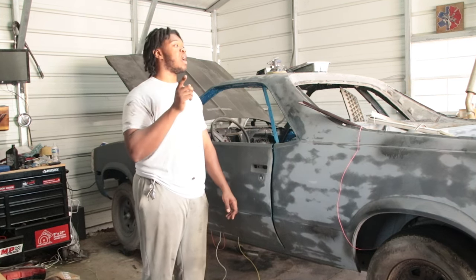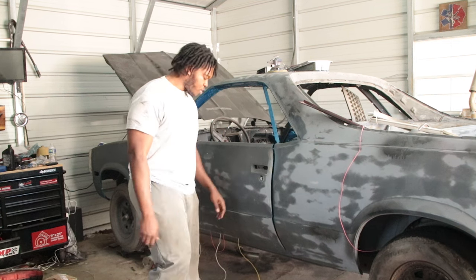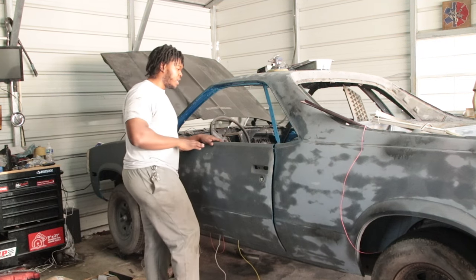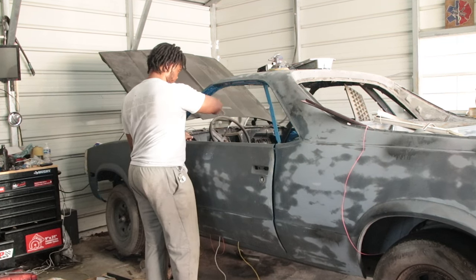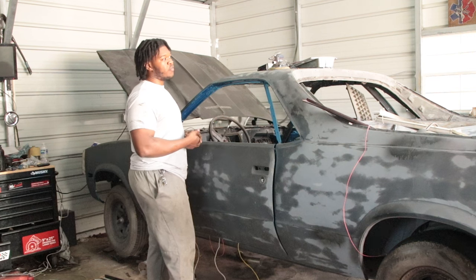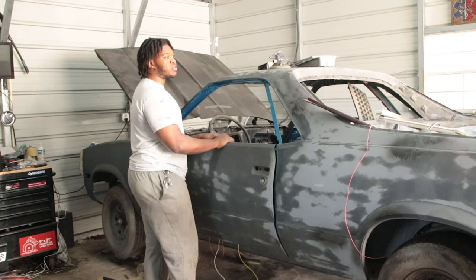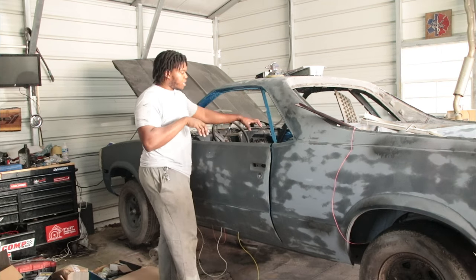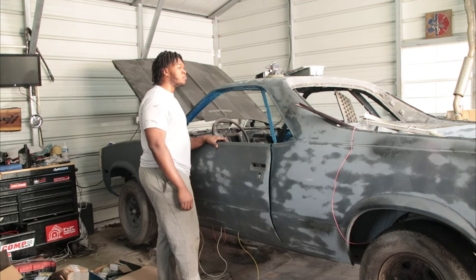That's one thing I would have done differently — I would have literally bought the complete floor. If you've got two floor pans in the car, just do the complete floor. All you've got to do is cut the old floor out completely, drop the new floor in, and then weld it around the edges. That's it. Versus me — I had three individual pans. I had to weld in the pans, measure it, cut it, go to the other side, weld it, measure it, cut it. I had to put all of the bracing and things back into the floor. If I had to do it again, I would just buy the complete floor.